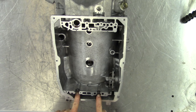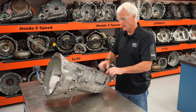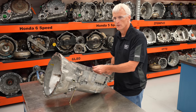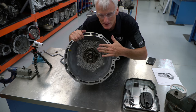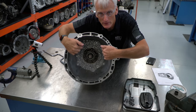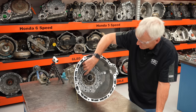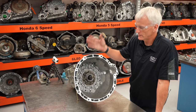I've got two more bolts back here — T45s — that hold the rear B2 clutch housing. I'm going to pull those out now. The neat thing about this transmission is I can lay it on the bell housing and build it up right on the bell housing like a tower. But first I have to pull all the bolts out from the inside — some T45s and some T27s. The T27 bolts around this circle hold on the B1 clutch housing, so I went ahead and took those off now too.